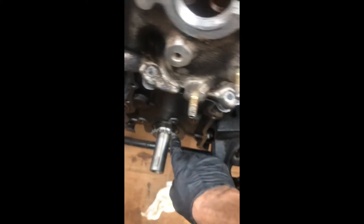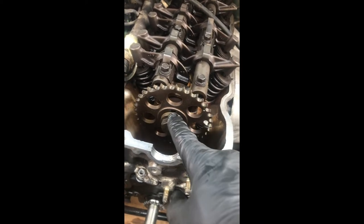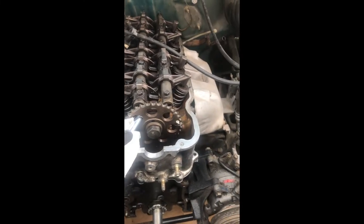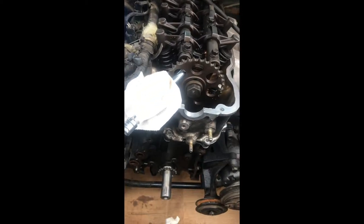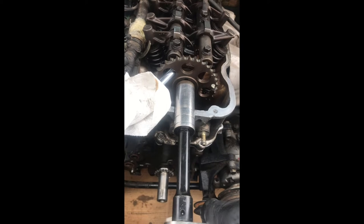I put the bottom sprocket back for the crankshaft with the dot so you can see it better when you put the chain. I marked it, and like I said, you need to make sure this arrow here is aligned with this notch. I took the sprocket for the camshaft first — I put an extension here as you can see, then I'm gonna use 15-16 to try to break this one loose.